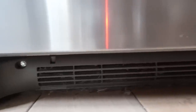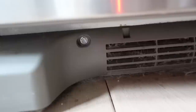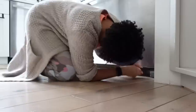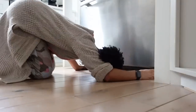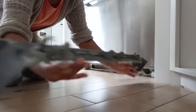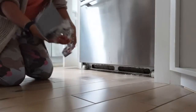The first thing I wanted to take care of is the condenser coils on my refrigerator. I don't know if y'all have cleaned your condenser coils lately, but look how much hair and dust and junk has accumulated down here. Disgusting. I know that Clover has been losing a lot of hair lately and a lot of it has gone here. I wasn't able to just pop the grill off — I needed a flathead screwdriver. If you clean your condenser coils, make sure you turn your refrigerator off, unplug it, or turn off the power to the fridge because you could really hurt yourself.